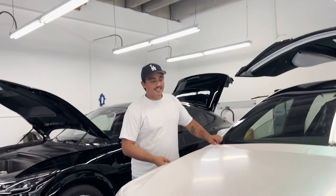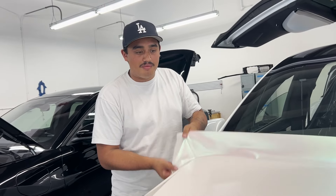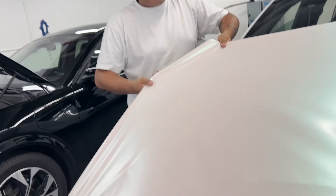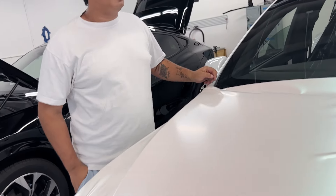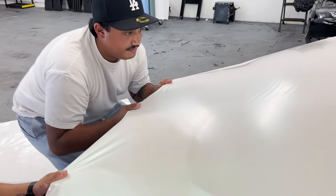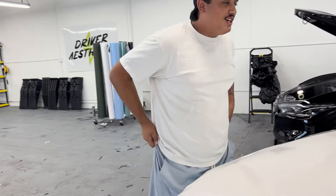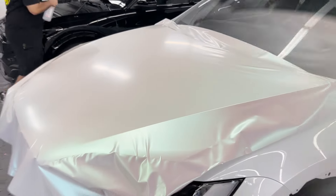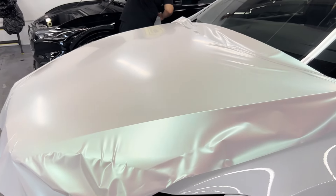The triangle method is basically pulling at two points to make a triangle with your arm and the vinyl, keeping it under heavy, tight tension. The goal when laying any vinyl is to get it glassed out — meaning there are no major wrinkles or air that's going to get trapped. Glass it out completely for a super easy installation.